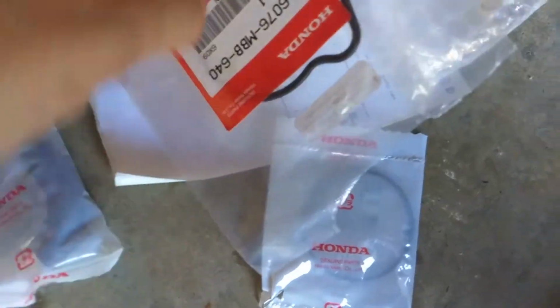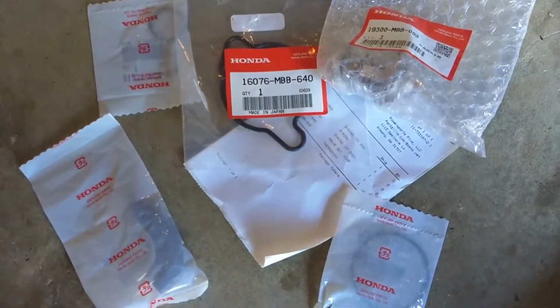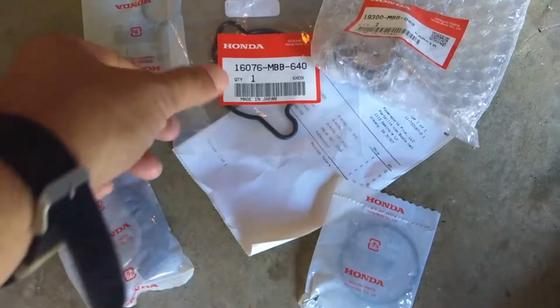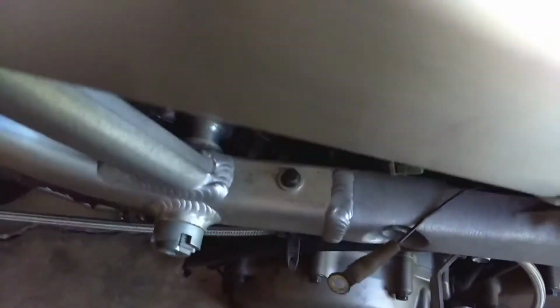And then I got, and this is going to be the stupidest thing when I tell you what I did, all my genuine Honda replacement gaskets. Thing of beauty, but there's one thing missing. One of these. Dumb me. These are from Partzilla, by the way, which was great. I thought I ordered 2 of these. These are the carb gaskets, and I only ordered 1. I double checked everything. Those are the gaskets that will go right here, actually, the air box to the top. So the good news is I can put this all back together. Worst case, if I detect an air leak underneath this tape, I can order another one for like $2 and replace it. I totally meant to order both, completely forgot.